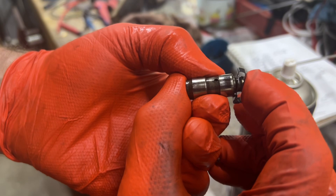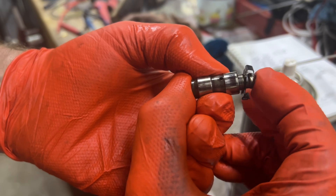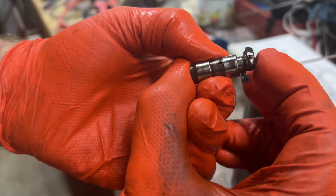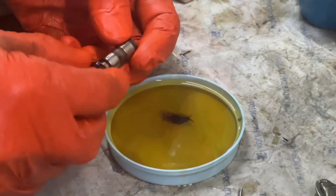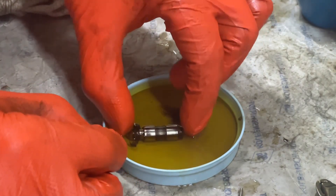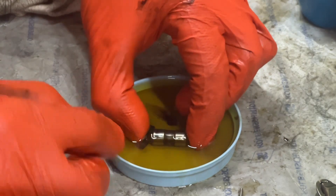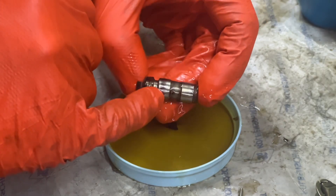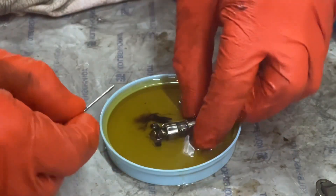This is a hydraulic lifter that has been totally drained and emptied of fluid. I've cleaned it out with some parts cleaner and now it needs to be checked to make sure it will actually work as a hydraulic tappet or lifter. This is a tub of fresh oil. As I pump it we're not seeing any air bubbles come out of the side oil entry hole, and that is because we need to release a valve deep down inside.